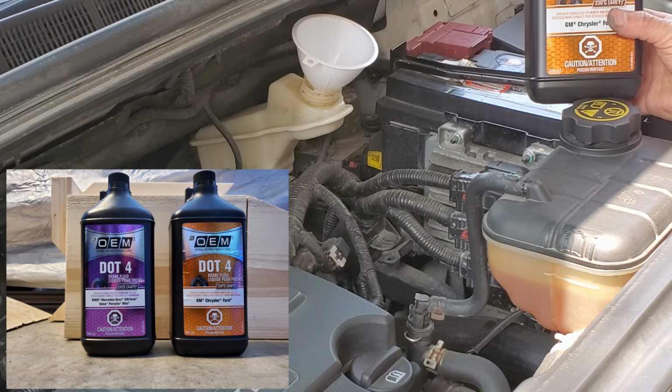As I stated earlier, if you do not have a pump or prefer the two-person system, again you hook up the tube to the bleeder screw and the other end of the tube is submerged in a container of old brake fluid so that you do not introduce any new air into the system when bleeding the lines. Open the screw and have someone slowly pump the brake pedal all the way to the floor, and then slowly release. Keep doing this until you notice no more air coming out of the caliper. Once this happens, have the person hold the pedal all the way to the floor, and then you tighten the bleeder screw. This process can take anywhere from 10 seconds to up to 5 minutes per caliper, depending on how much air is in the system. Be patient and do this job correctly.